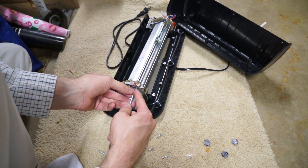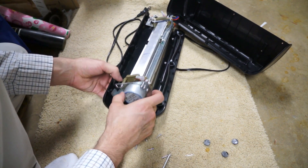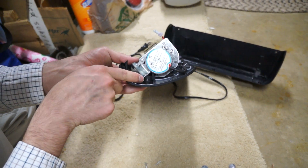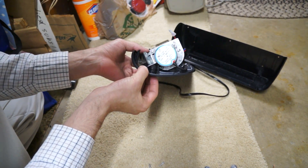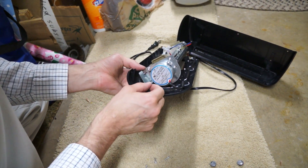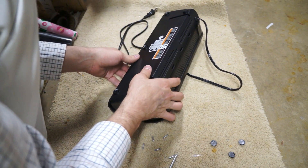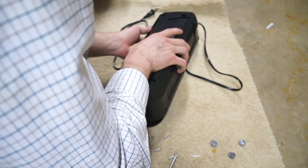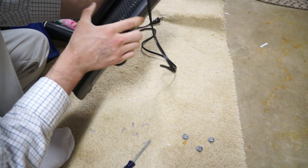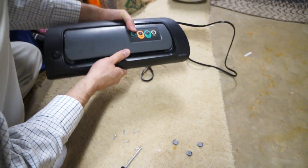Finish putting the screws in. One of the tricky things about putting the case back together is the release button — sometimes it doesn't really go in nicely and you'll have to sit there and play with it. There is a kind of beveled edge on the release button, so when it goes in it slides. Make sure it's down in the little notches with the little hook thing in the back so it slides nicely to allow the whole thing to pivot. If you're forcing it, that almost always means the release button is not quite seated right — it should come nicely together.